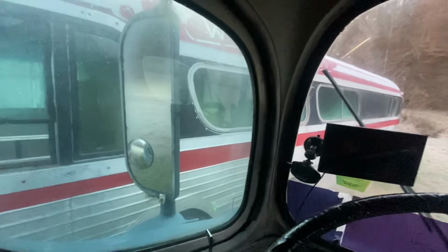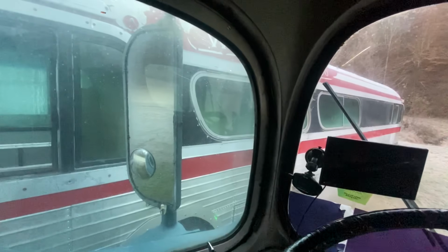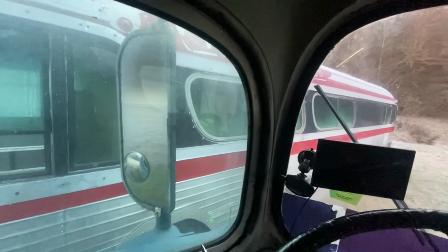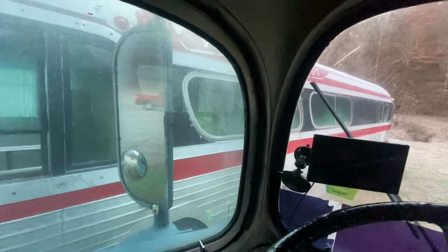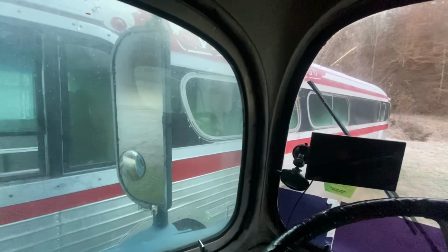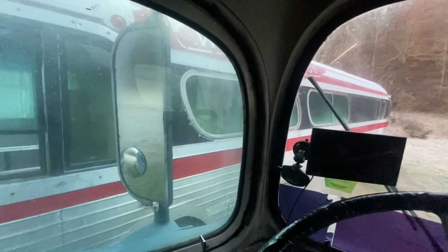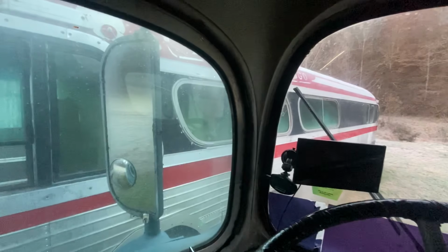We're gonna add spring brakes to it. Since the emergency/parking brake is disabled on it, it's cheaper and easier and safer to go ahead and add 2 30/30 cans on it with a PP1 valve and so on. So it'll have a modern emergency parking brake setup on it. Other than that, everything looked real good on it.